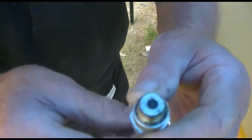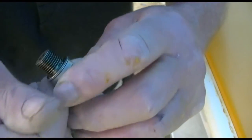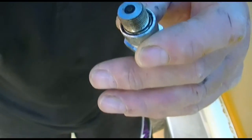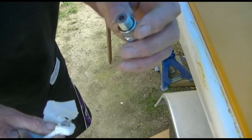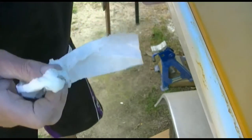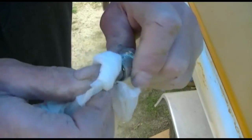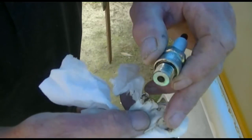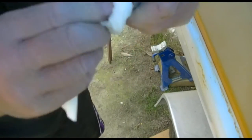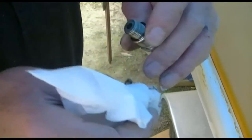Just pulled out a plug to see if they were fouled, with the WD-40, and it looks like there's a drop of water on here. I hope it was in the fuel and not in the cylinder. I'd better pull the rest out and check them. The second one looked a bit gummy. I just cleaned it with some acetone and it came off the end, so it's got to be the WD-40. I'll bring number one up. I only wiped the water off my finger before, if it was water. Now some of that's off the thread, but in the middle is a bit around the centre pin. I wonder if you're supposed to wire brush them, or just let them run until they've burnt away to rubbish.